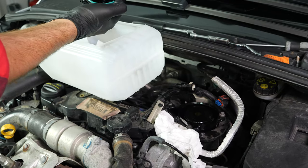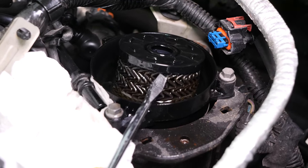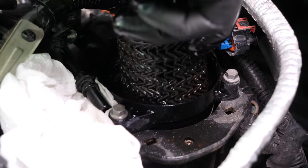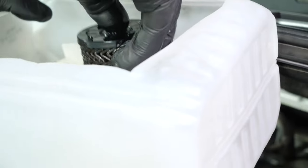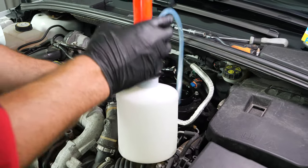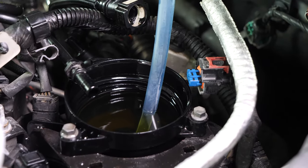Place the flange in the container. Using a large flatted screwdriver, lever off the washer of the diesel filter so you can remove it. Place a container to collect the liquid underneath. You must now drain the filter — using a syringe or a hoovering tool, remove the diesel so you can completely clean the flange with a paper towel.